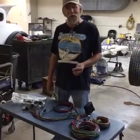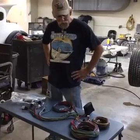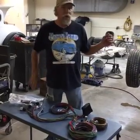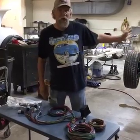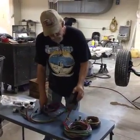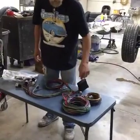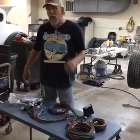I'm going to point out two or three tips and I'll put a star by it, so you get a star by this one. Your alternator puts a lot of amps out and it's really not fused. You can put a fusible link in it, but if I got a 100 amp alternator and I'm charging that through the system here, it's going to go directly to the fuse block, and you can see the big thick wire in here, it's going to come from the alternator and then go from here and charge the system through the battery.